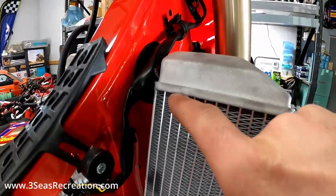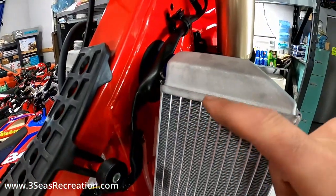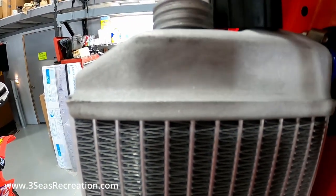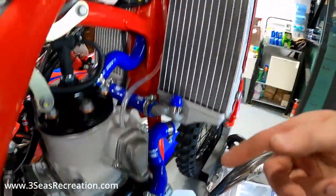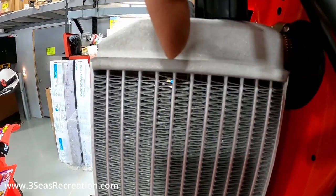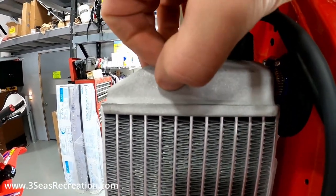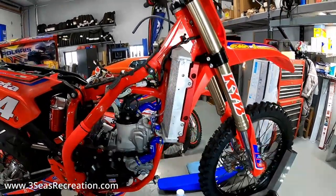There's no special way that you need to bleed this. What we always recommend is filling it all the way up and above the cores in the radiator. If you look down in the cap where they end, you don't want to top it completely off to the top of the neck - you want to fill the coolant about halfway up. You'd want to run the bike for about 10 minutes, let the water pump circulate stuff through, and then recheck it. You only ever want to have it about halfway up. We found in the years past of racing these, if you fill it up too much you're just going to blow it back out.